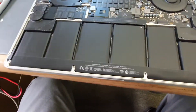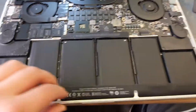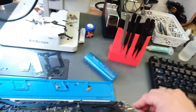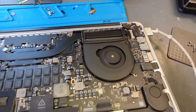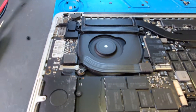The first thing you want to do is connect your charger. This is a 15-inch Retina board. Let's open it up. When you connect the charger, you should see the fan spin — and there it is. The fan spinning is a sign that the machine is turning on, but there's nothing on the display. Fans are on but no display.